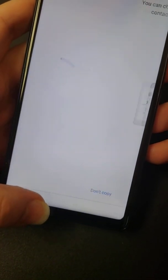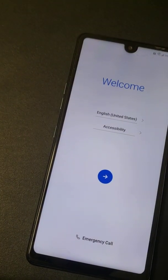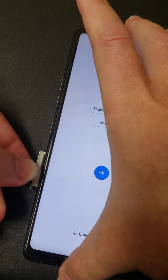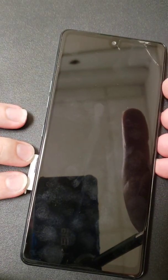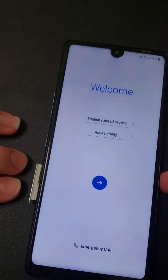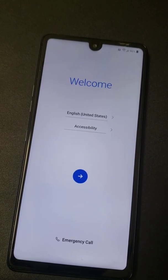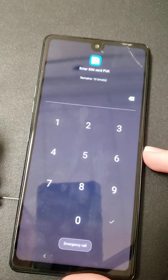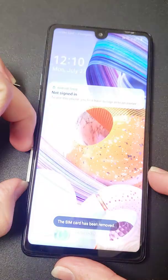Go all the way back. Now, one of the things they patched at the beginning screen is when we do this PUK SIM lock — when you go to remove the SIM like we would in last week's Stylo 5 video, it now resets the phone. They programmed a variable where if the SIM card is removed, it automatically resets the phone. We're going to utilize that though, so we're going to insert it. I'll pull it out so you can see the reset I'm talking about — PUK lock comes up and we remove it.